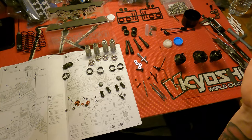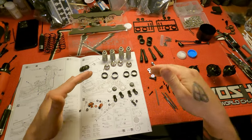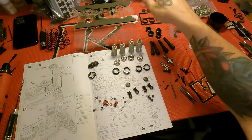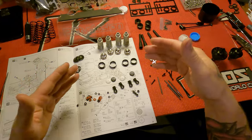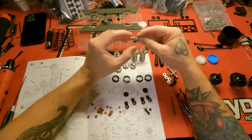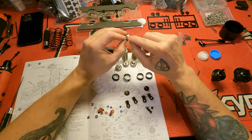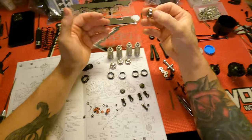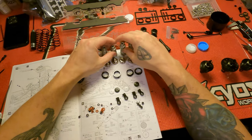Just like with the differentials, you want to start with getting everything laid out. I've already got everything laid out and parts cut out — your shock rod ends, spring caps, and cap bushings. The only modification I make to my shocks is drilling out the bleeder hole a little bit to help bleed air out. I saw Adam Drake do this in an old video and I've always done it since, though I can't say for certain whether it makes a difference.